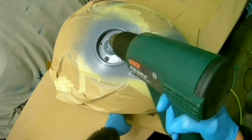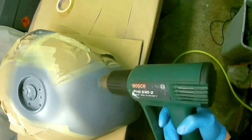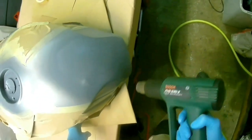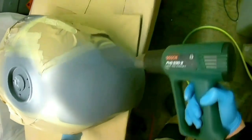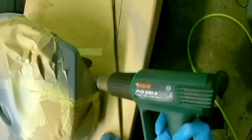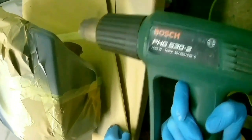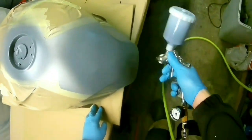Putting a lamp or heat gun on primer straight away doesn't seem to have any effect on it. With base coat - I normally use solvent-based, not water-based - it also has no effect. But if you rush in with a heat gun in cold weather on top coat, it may not even out as well, and you can also get small solvent pops - solvent bubbles trapped in it. So you just have to be careful. There's no problem at all with primer or solvent-based base coat getting some heat on it straight away in cold weather.